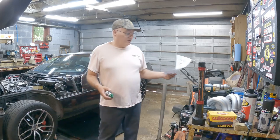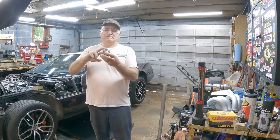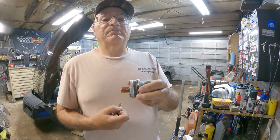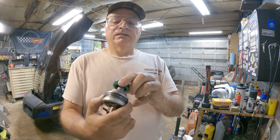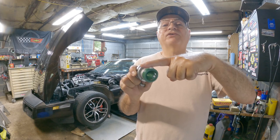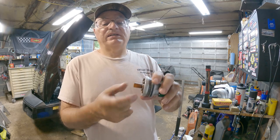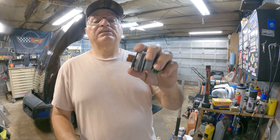What you do is pull the VSS. There's a little plate that goes over the top of it — I'll show you that shortly. This plate slides into the transmission. This plastic gear gets engaged with a gear that's on the shaft; the shaft runs back to the propeller shaft or drive shaft. This is on the side of the transmission, and it spins this AC generator and sends a signal to the computer. It goes in only a certain way and is held in with the plate and a bolt.